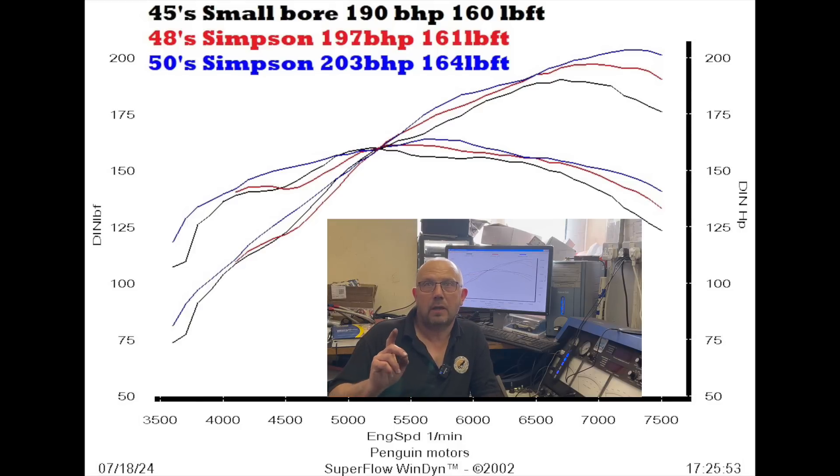You may have noticed that the number on the inset power needles doesn't always exactly match what I say. The reason is that the inset video footage showing the dials is uncorrected data, whereas the numbers I quote to you are always corrected for temperature, humidity, etc. Sometimes you'll see a bit of difference between what I say and what the meter reads. The meter in that last pull showed 204, and I called 205 brake, but when I look at the data it's actually 203. But hell - 203, that's brilliant.